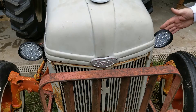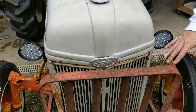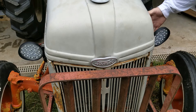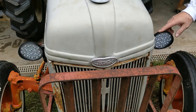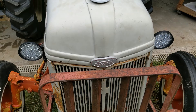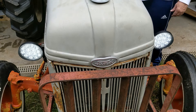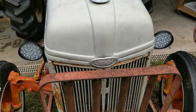These are the front headlights — they're small and lightweight. What I like about them is if you're in the brush and you hit a branch or something, they'll just fold back out of the way and they won't bend your sheet metal up. These each draw about 0.6 amps and they're pretty bright — a lot brighter than the stock incandescent light would have been.